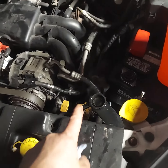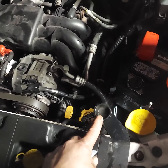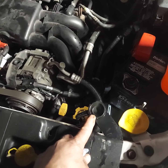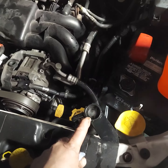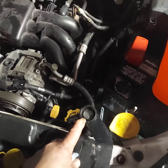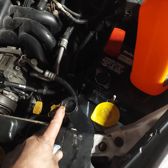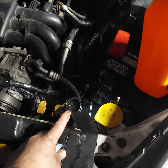These systems don't have filters on them and you don't want to clog up radiators and heater cores, so don't pour coolant in there straight. Use 50/50. If you have to use well water, I hope you've got a softener to get all that iron out. Use really good clean water 50/50 with your antifreeze — especially in winter you're going to have a problem if you don't. We'll get this up to operating temperature and make sure we've got all the air out of it.